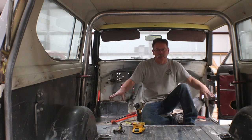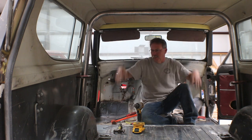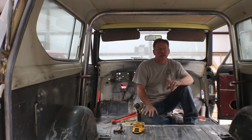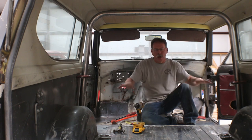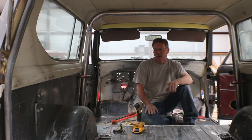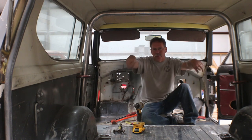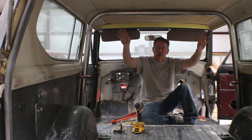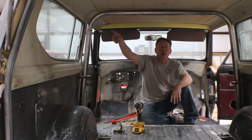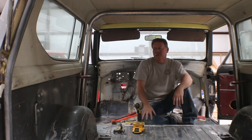Once we get this tacked to the plates and welded to the floor, then we'll come off this and start building our down bars to the back. You could get everything really well tacked in, build the down bars, then take the top off, lift the whole thing out, weld it all up, and put it back in - and that would absolutely work. I just really don't want to be taking the top off anytime soon, at least not until the bottom is undercoated and set on the frame to keep it as rigid as I can. For that reason, I'm going to go ahead and weld up the base plates solid and weld them to the floor, then tack the down bars and weld in as much as I can.